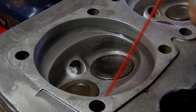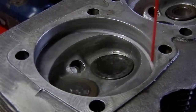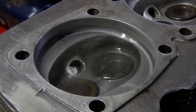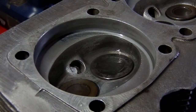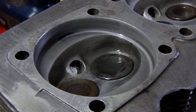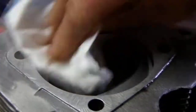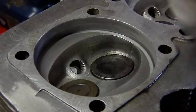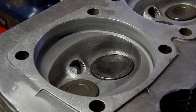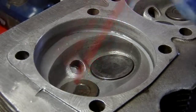It works pretty good — a little hard to get good fuel for it but it does work well. But increasing compression by hot rodding it up that way isn't really the right approach for power. You want to make sure you do proper deck work to get the right height on your piston and sleeve at install. That controls your overall compression ratio based on the volume of the cylinder, which you can also change by putting a shim underneath the barrel between the barrel and the block.